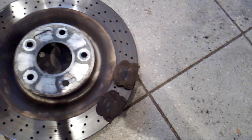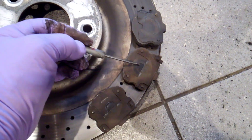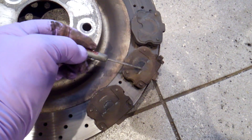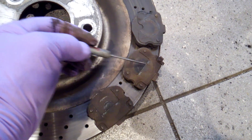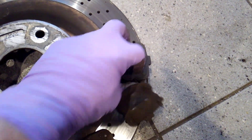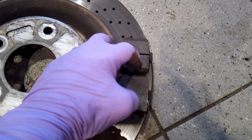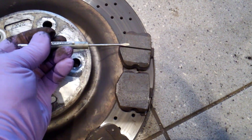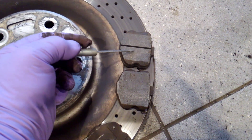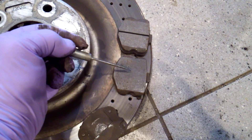Take a look at this different design. This is a General Motors brake pad — it has a shim that only sits on half to create a little pad taper. This is an aftermarket brake pad which was installed on the front of this Grand Sport. This is an outgassing slot, and aftermarket brake pads do put these in from time to time, whereas the factory brake pad does not.